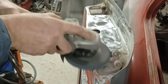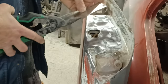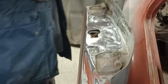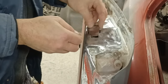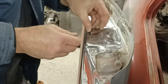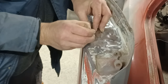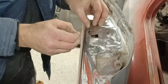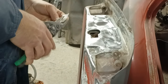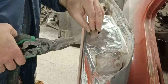That's nice and bright and shiny, ready for some welding. Now as I cut this piece I'm not messing around — I'm cutting it to size but also leaving it long. You'll notice as I offer it up and then trim it to size, I leave a little tab sticking out at the end — I did that on purpose because it's a lot easier to keep hold of a bit of metal when you first put your initial tacks in. I've got an old precision screwdriver there where I've just sharpened the point up to use as a scribe — that's a cheat because they're a hardened metal on the end anyway. Quick snips, quick test fit, snip off again.